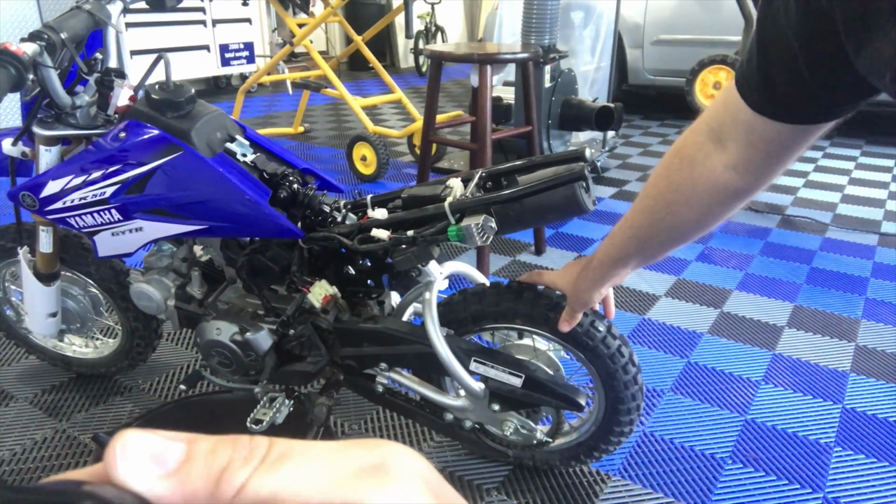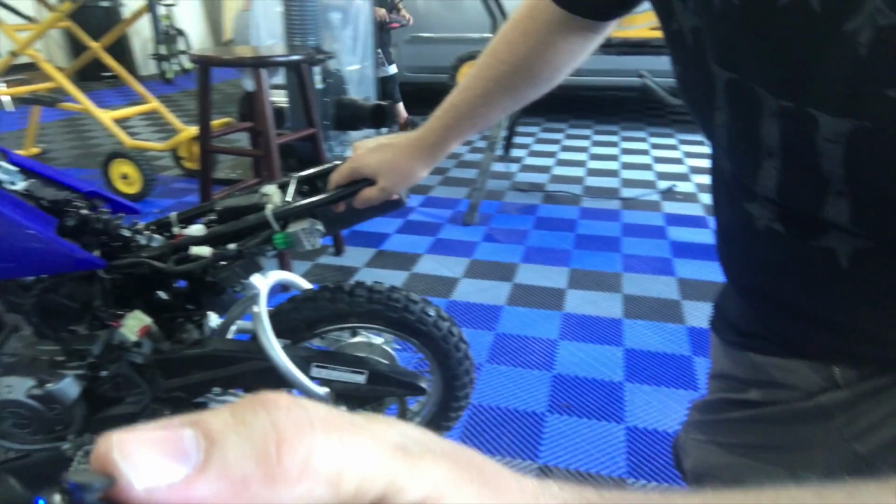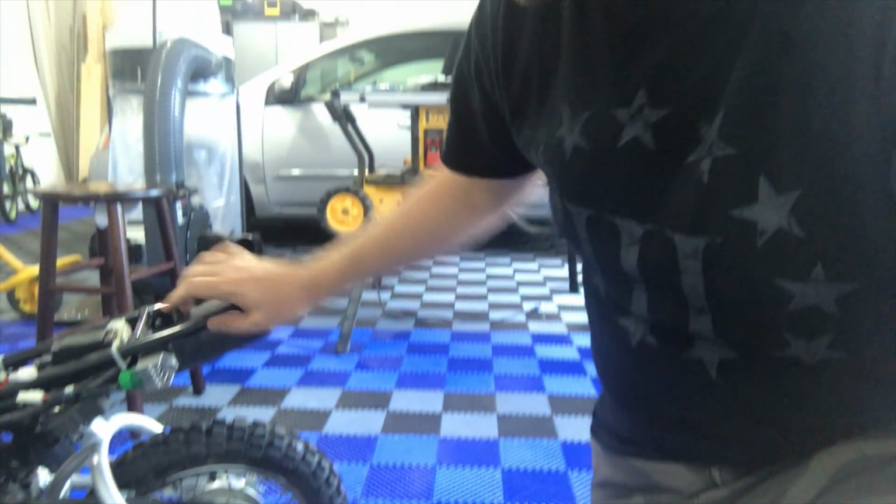And to make sure that they always have enough tire pressure in the tires, because if they don't have enough pressure, the wheel can actually spin in there around that tube and just strip the little valve stem that comes out. So that's the number one thing, is he said if you just always check the tire pressure when you go out, it's going to save you a lot of money and headaches. So number one is the tires.